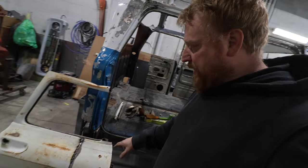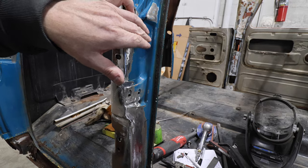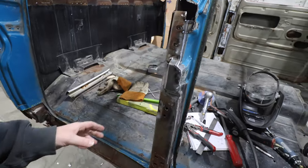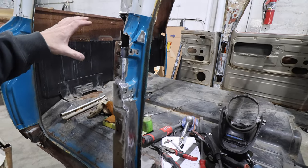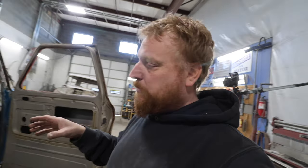I just kind of glued the door together, got in there trying to make sure my distances are good, but I noticed this whole B pillar was really flopping around — basically just had some support down in here, not a whole lot. So I added this and built it out because our door striker is going to sit in here and it pops out a little bit. I already had the door on and open to make sure it would clear and not hit inside the door when open. I went ahead and burned this in, ground it down, and got these little pieces tacked so they don't fall out. Now I'm going to cap this off, but I'll probably extend the upper door hinge first to make sure it's not adding a bunch of stuff in the way. This gives the B pillar quite a bit more support so I can cut the front of the B pillar out and try to fix our twist.